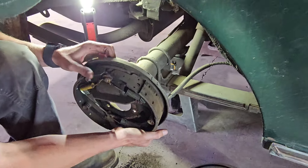This is a 5/16ths flare fitting that goes directly into the rear. Using a small tubing cutter, I'm going to cut this flared end off so we can slide our fitting off to reuse it, then put it onto the line in the car to tie into our proportioning valve. We'll also remove the fitting from the rear brake line. This is our flaring tool — we're going to do a double flare on the line. Insert the 3/16ths die, put it on the 3/16ths slot, get these nice and tight, clamp it down, and get our first flare. Then remove the die and press down to get our external flare. And that's a perfect double flare.